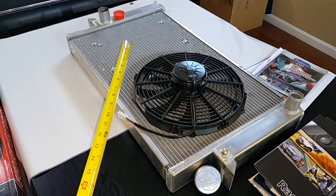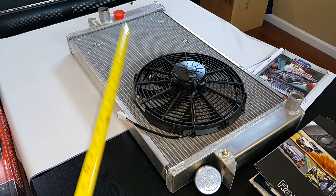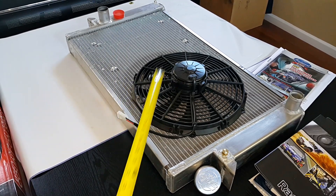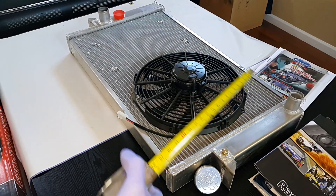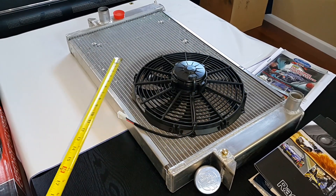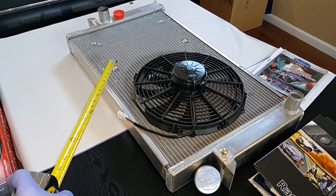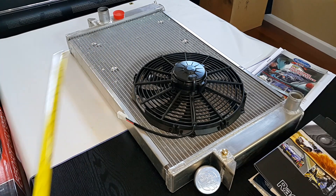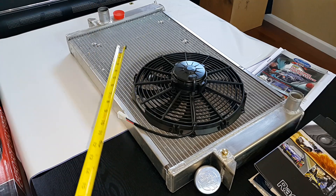This is what comes inside. What you don't see are the relays and wiring harnesses for the fans. There are fan brackets that attach the fans on all four corners to the radiator — that's why you see these indentations. Those are from the rubber spacers that support the fan when it's vertical inside the car.